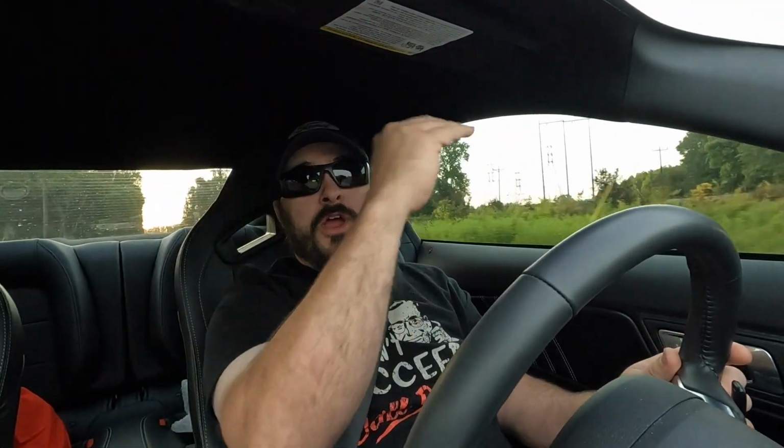I'm showing you each pulley, and usually that's something I don't do on a dyno. Typically, once the tune's dialed in, if I change boost, I just show you the difference at the drag strip. I don't really go back to the dyno. However, I'm wanting to compare each pulley, and like I did in the video, I'm wanting to show not only peak numbers, but the mid-range, how much horsepower you pick up, where you pick up, to show you guys exactly what it does.